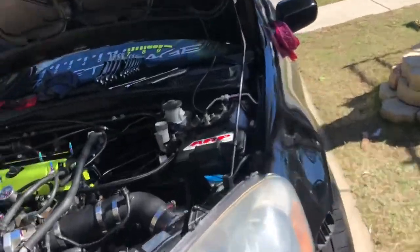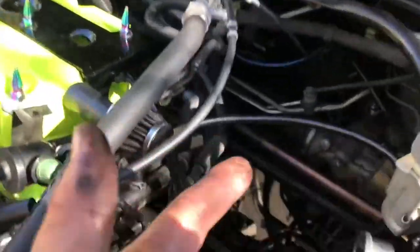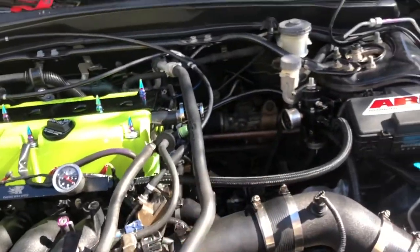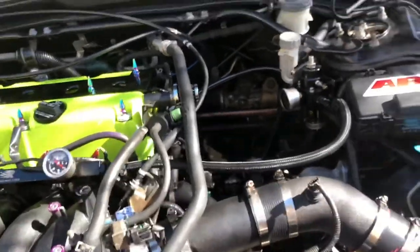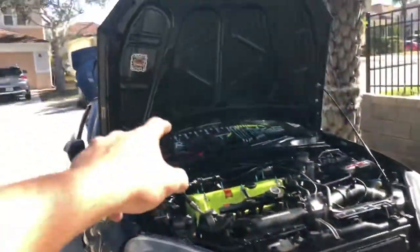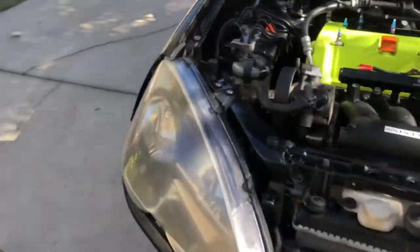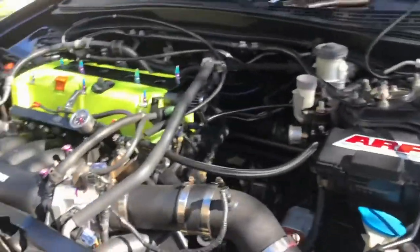It is Christmas Day and I'm going ahead trying to do my power steering thing. I just disconnected it from the rack. I did try to do this in the junkyard — it's probably the hardest thing and I stripped it. I let it sit in WD-40 for a couple minutes and it broke loose, so I'm really relieved about that. I'm hoping the second one doesn't give me a problem. I have the line ready to make the new line so I can delete all this extra stuff and put on the pulley that Nate got me for Christmas.